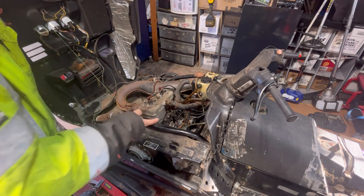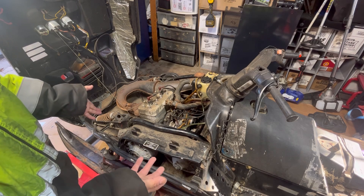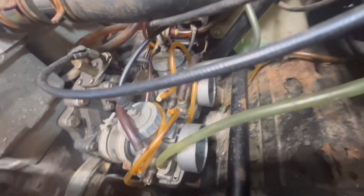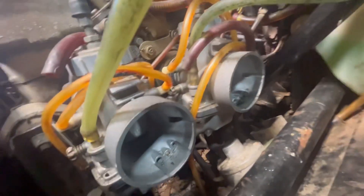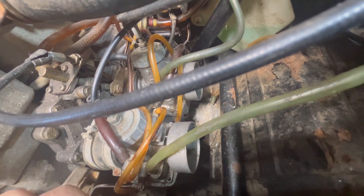What bothers me is the air filters. I know they say snow machines like snowblowers and snowmobiles don't require air filters because you're running in snow — no dirt, dust, or debris. However, when you look in here you've got those two carburetors with the mouth wide open. When this is running, it sucks like a vacuum cleaner — any dust or debris will eventually get stuck in there and clog your carburetors.